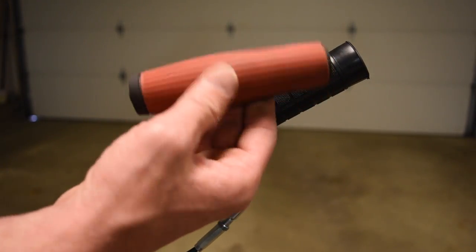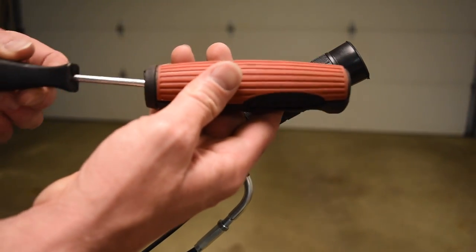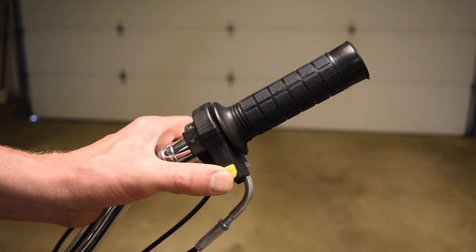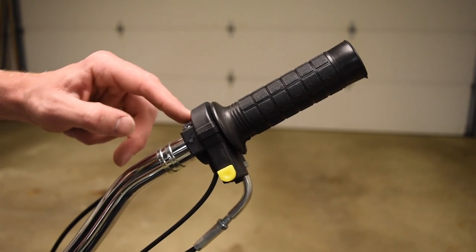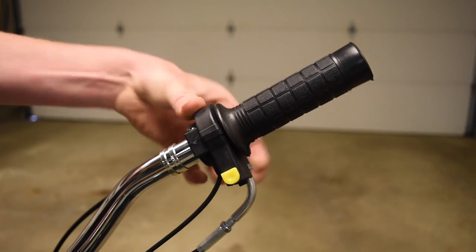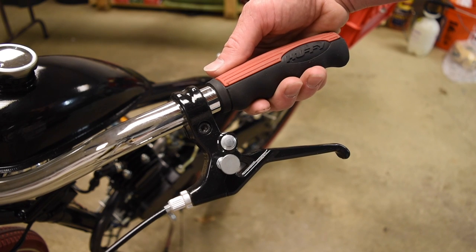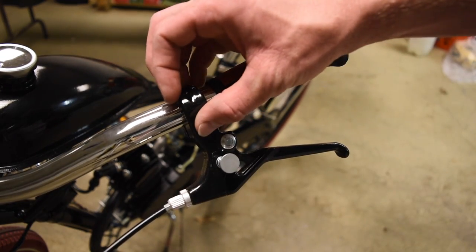Originally the bike had a Huffy brand grip on the right handlebar, but I had to take that off. I used a screwdriver, put a little soap on it, stuck it in around there and was able to pull the old one off and put the new one on. Here's the kill switch on the bike — if the engine's running, you can just hold this down and it will turn the engine off. Inside the body of the kill switch there's one screw that needs a hole drilled into the handlebar. I just took a little tiny drill bit, drilled a hole right in there, and that screw was able to pop right in — that's to keep this whole thing from spinning around when you're pulling your throttle. On the left handlebar I was able to keep the Huffy brand hand grip, but I did have to take it off to put the clutch on. I took it off, slid on the clutch, and screwed it down.